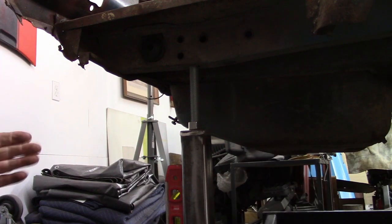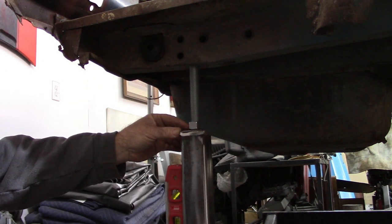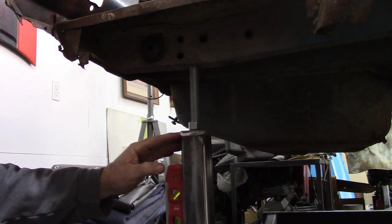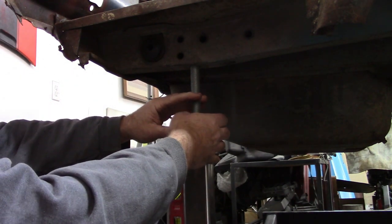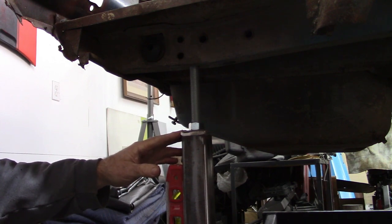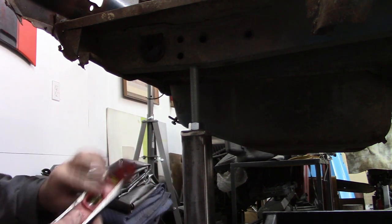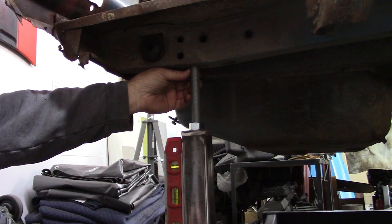To give you another angle on this — as I was saying about the angle of this post, this is how much room of movement I have within that slotted area. The goal, once I get this level and square, is to have this all-thread riding in the middle of the slot. If I take this jam nut and lock it down, that eliminates the movement of the bolt and tightens up the limits on the post itself. With just a little bit of movement, my bubble level levels out nice, so that'll be the goal — put a little tension on that and tack it in down below.